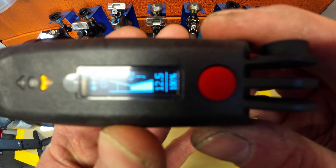Now we're in the booth. I've already panel wiped down off camera and I'm just giving it a final clean down with a tack cloth ready for the base coat. I'm looking forward to using this new Walcom light — it's something I'm eager to test. I previously used a Luma gun light and found it actually hindered visuals in some scenarios, which I believe was because the light is on one side and doesn't give an even spread. This new Walcom light is a 360-degree around the air cap light, so my logical thinking is it'll spread the light more evenly across the panel you're spraying.